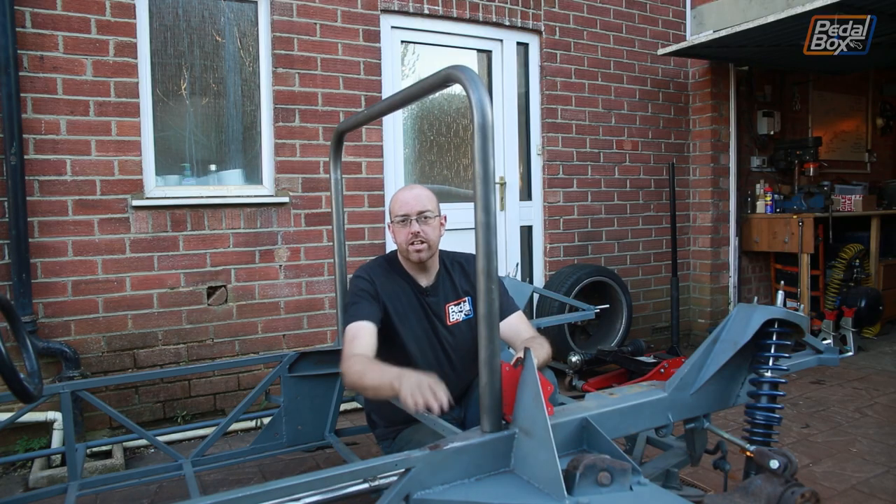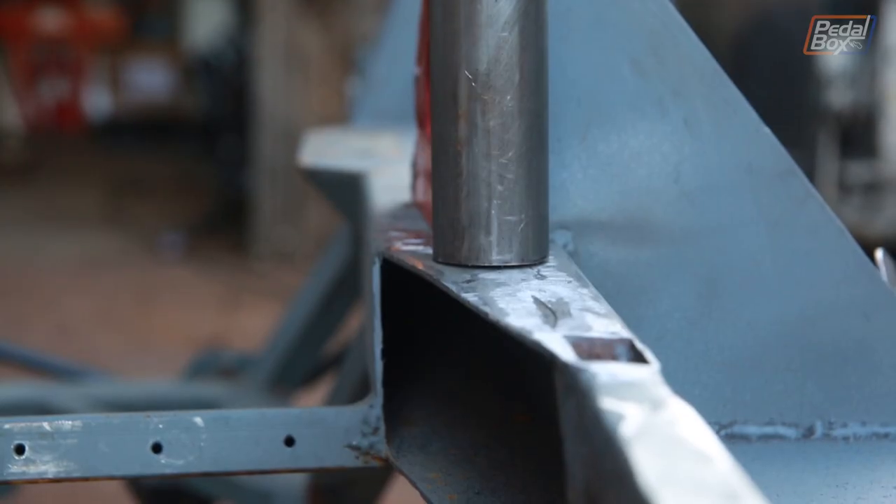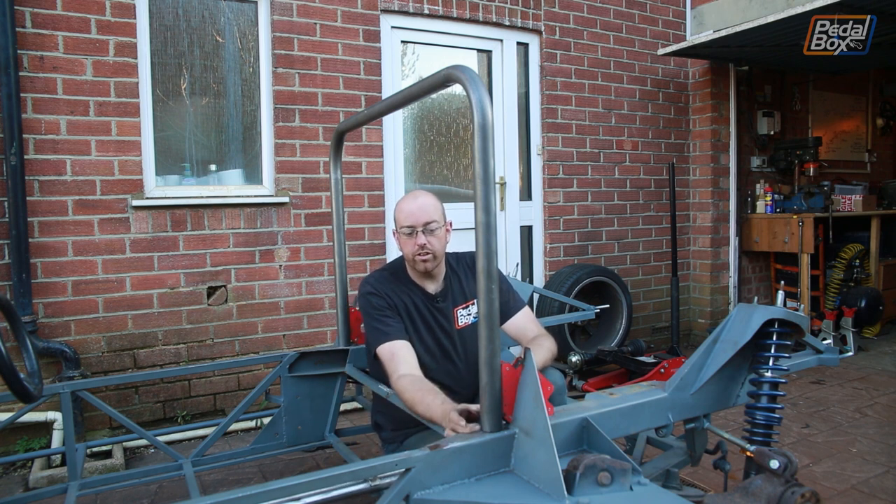That's the top of the chassis legs cleaned off and I've cleaned off this crossbar. What I might do is sink down through the top of this rail and mount this onto the very bottom edge of the inside of this rail, rather than having it stuck on the top.